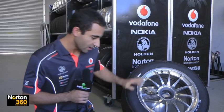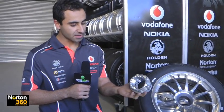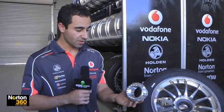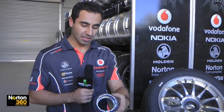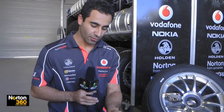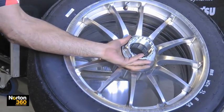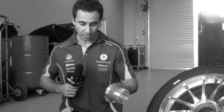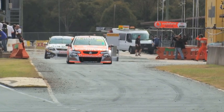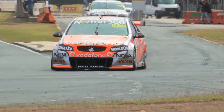The wheel and tyre is held in by a central one wheel nut. This weighs about 450 grams, and it's machined from a big bit of aluminium and then machined down to this nut here. It's captive also, so these little teeth here locate in the centre of the wheel. That means during a pit stop, the wheel can't fall out — so when the guys take the wheel off, there's no chance of the nut falling off and firing down pit lane. It's basically a safety feature, because those things travelling down pit lane is not a good thing.